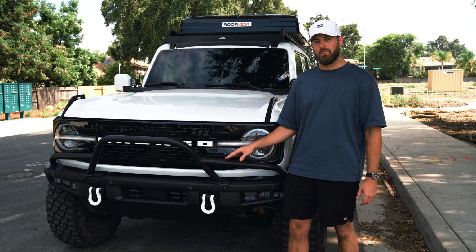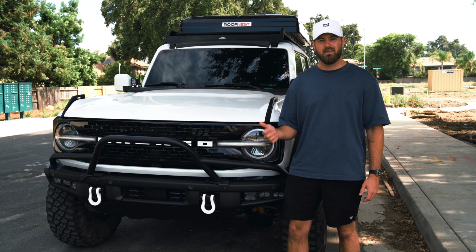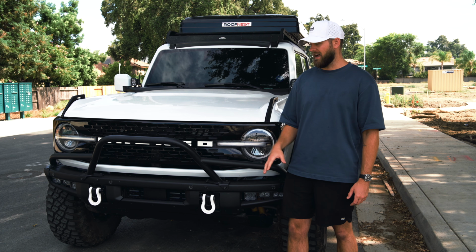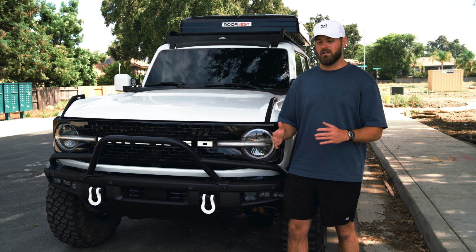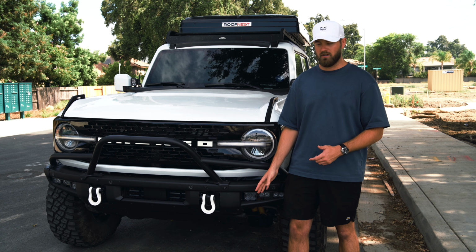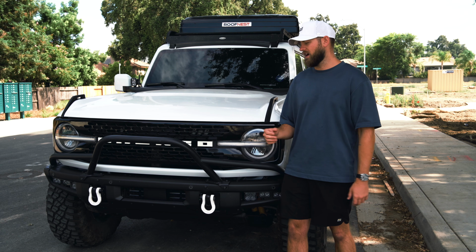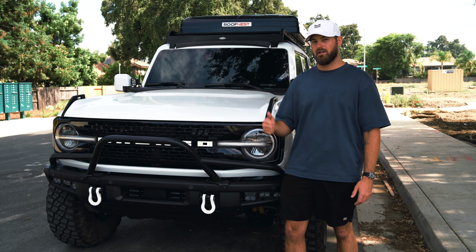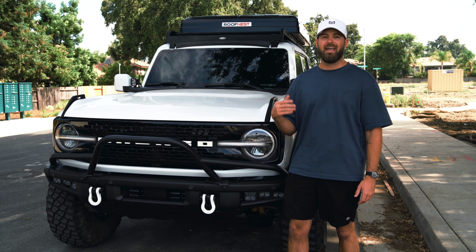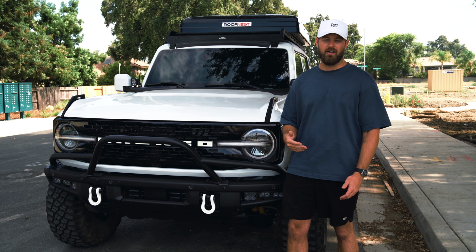Now beyond that, most of the time, as long as I keep momentum, I can just put two-wheel drive in and then throw on my rear lockers. I have not really been in a situation to throw on my front lockers, and I know there's some sway about that with the front tie rods, or obviously the only tie rods in the front steering rack. But with that, I typically can get away with momentum and rear locker, or if I have to, I'll put it in 4x4 high and just use that to pull myself out.